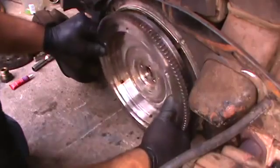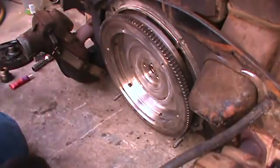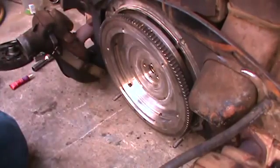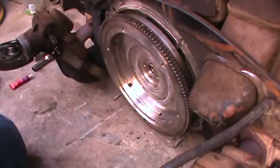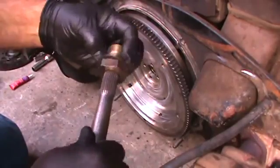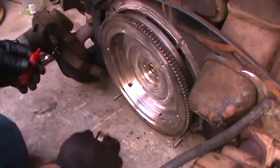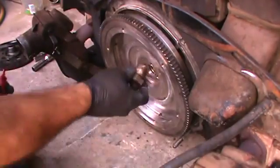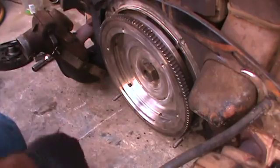Alright, we have a little lube on our O-ring, we have a little lube on the seal, we got our shim pack in there. Now we're going to throw the flywheel up here. A little back and forth so it doesn't fall down and decapitate your fingers — don't ever put your fingers on the bottom of these because they're dangerous. I'm going to go ahead and put a little Loctite on the nut, clean it up a little bit. Make sure it's lubed up in here where the input shaft rides in the back of it. I like the red Loctite — you can use the blue, but red's no harm no foul, that'll be nice and tight for you. You don't have to worry about the flywheel coming off.